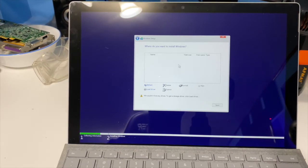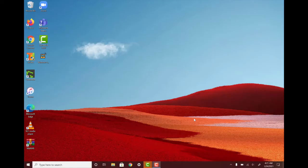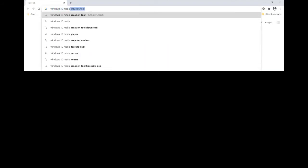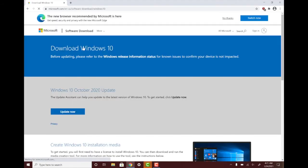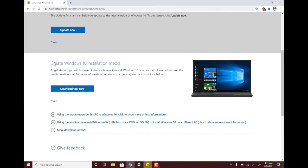So now we're going to get into how to fix it. We're on the computer side now where we need to make the drive. We're going to open Chrome and type in 'Windows 10 Media Creation Tool.' You're going to click 'Download Windows 10 disk image ISO file' — wait for the page to load. Sometimes this Microsoft site is really slow and other times it's really fast. There we go — you're going to go down to 'Create Windows 10 installation media.'